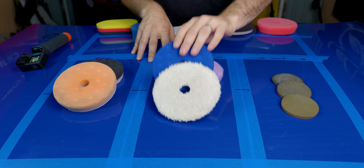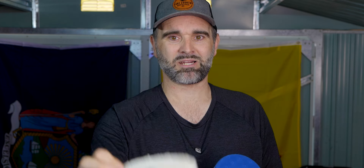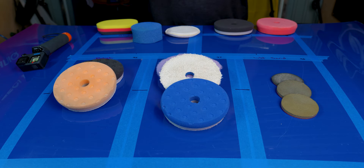On to compounding then - this is the more aggressive process to get rid of deeper scratches, and maybe a little bit of light orange peel. For compounding we're talking about heavy cut foam pads, which are much firmer. All of these pads are from Lake Country Manufacturing. My go-to is the microfiber pad - really really aggressive. When you do compounding you're going to leave some hazing behind, so it's not a one-step process. You may be familiar with wool pads from body shops - those are even more aggressive, something you'd use on gel coats. Once you've done the compounding, you then go back to the polishing stage to refine any marks left behind.